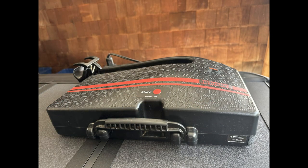Next, you must install your auxiliary braking system. 49 out of 50 states and all of Canada require an auxiliary braking system. Tows come with either vacuum brakes or active brakes. Make sure you know which you have. A Jeep Wrangler is a vacuum brake. Ford Mavericks are active brakes. If you try to apply vacuum braking to an active braking system, you're going to smoke the tires.